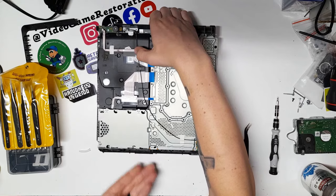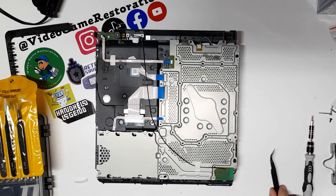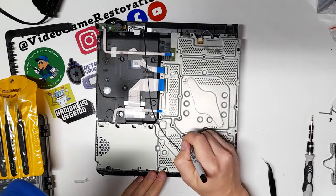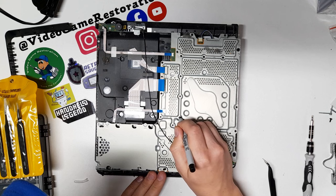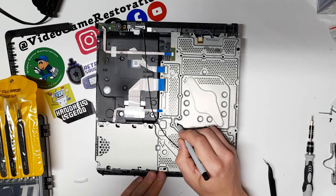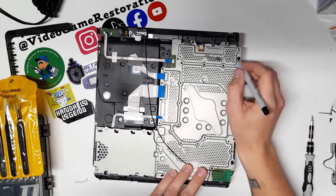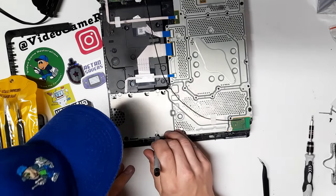We're going to start by removing all of these little tiny itty bitty screws. What I like to do — because you have black screws and silver screws and sometimes it gets a little confusing as to which goes where — I get a Sharpie and wherever there's a black screw, I just put a little mark beside it. This easily wipes off, and really no one's going to see it — it might even help the next guy. You can also color in the little triangles here, which just kind of tell you where these screws go. There are a couple hidden just back here.